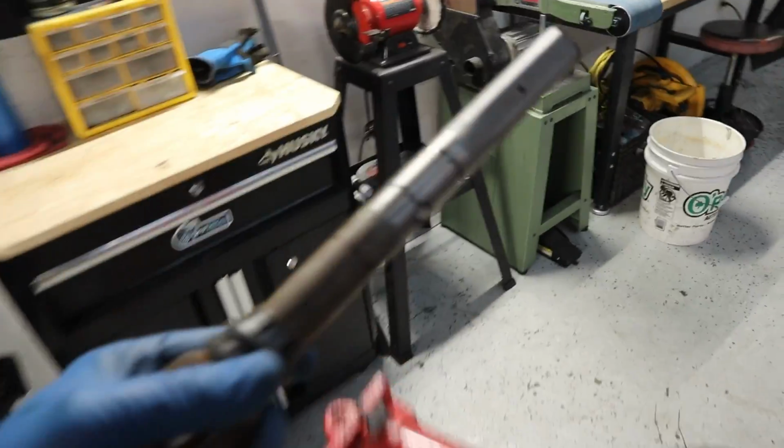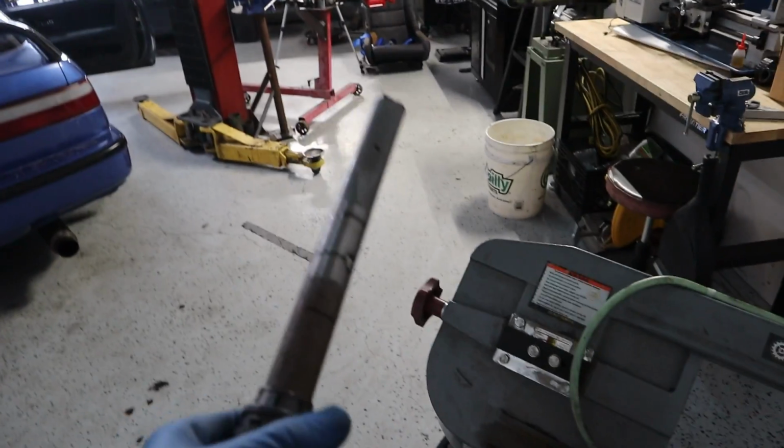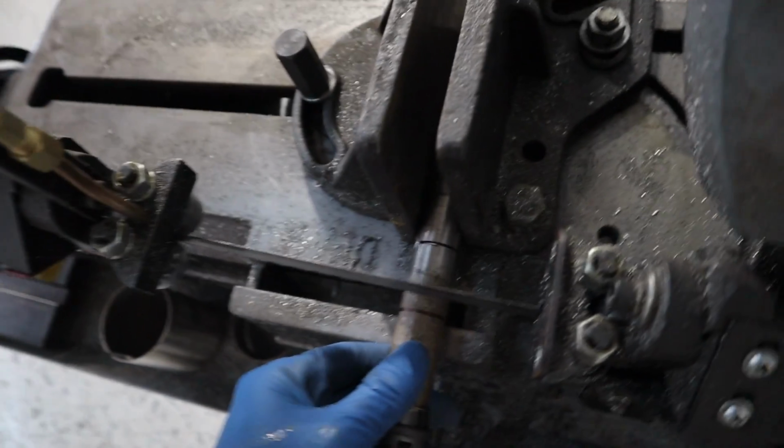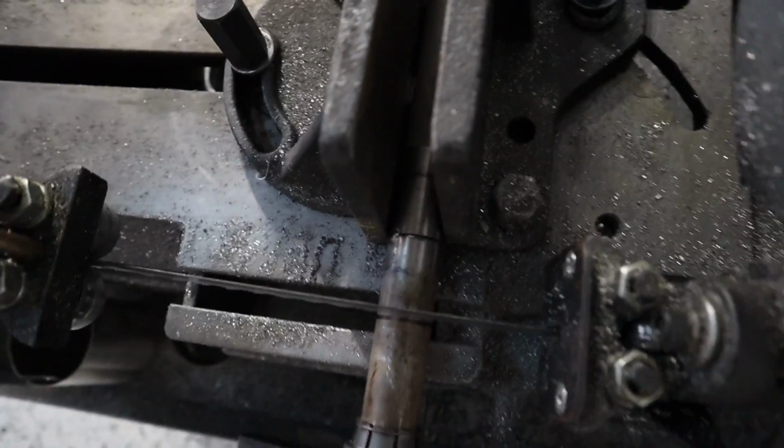And the reason I tacked the other end back on is so I could have something to clamp to, because for something like this, I'm just trying to get as straight of a cut as I can, because I realized I can't taper this because it is a tube in here and not solid stock like that. So I need to have a very good butt weld, and I'm still going to bevel and hot pass it just to make sure it's strong, but this is just going to make it easy for me to now line up and clamp just like that.